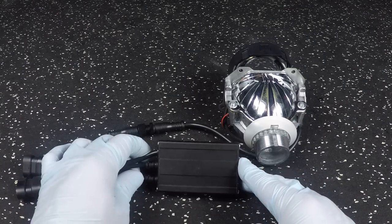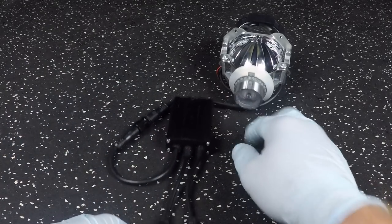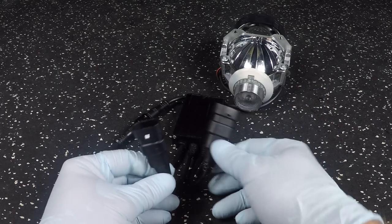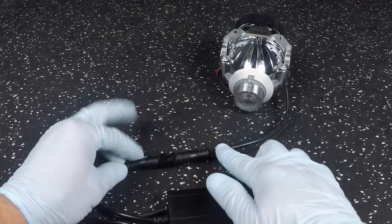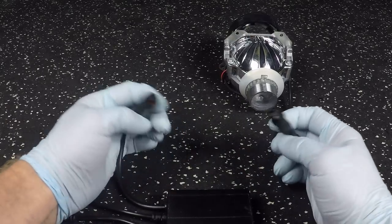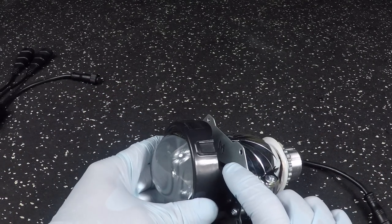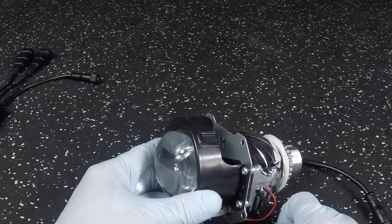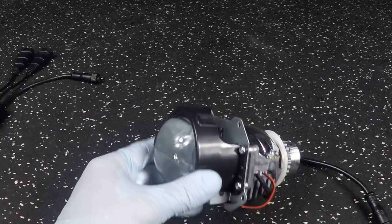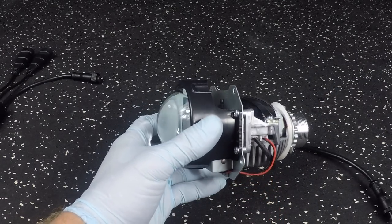Just a few notes on the product itself — this is the driver. It's going to have a laser-engraved Morimoto logo as always. It's a production version so it's a little different. These two inputs are going to be labeled like Morimoto harnesses — low beam on the right-hand side and high beam on the left-hand side. There's a disconnectable connection there. There's an M logo on the projector. They need to flip that around — they want the M to be seen from the driver's seat, not from oncoming traffic. If you don't want any logo cast on the ground, you put a piece of aluminum tape there and it's gone.